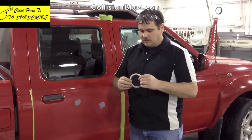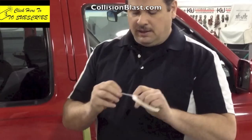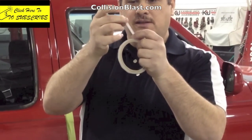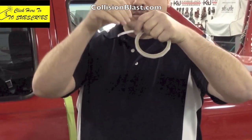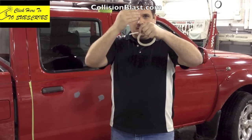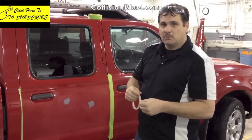What it is, it's a transition tape. It's basically just got the adhesive in the middle of it — sticky in the middle — and then both sides don't have any adhesive on them. This allows the paint to kind of bleed through the edges and transition to a smooth edge. So we're going to use this on the body lines.